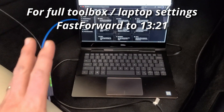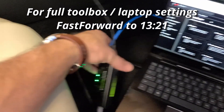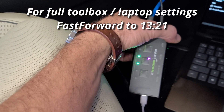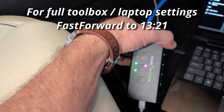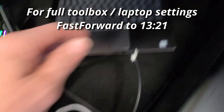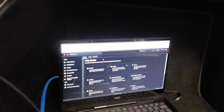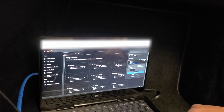So right now we're going to hop in and do the coding, then we're going to look at both of them. Just to refresh you — I covered this in the matrix video — we have the proprietary cable here, link is in the description, which goes to our Rad Moon. This needs to start in slave mode — you hold that down for three seconds. The green lights: one means you're connected to the car, the other to the computer. Once those are solid, you are good. We're powering it with a USB-C and then our laptop in the toolbox. We do have to hit enable over here — that puts us into gateway unlock service mode. So now on our computer, we just hit connect. Now we've connected to the car.